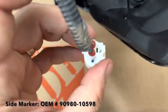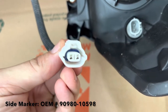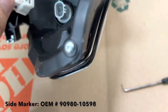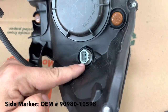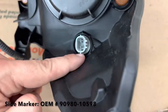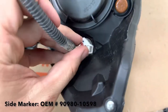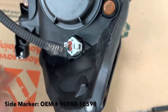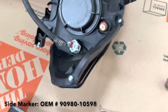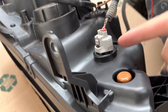Use a dental pick, and then the exact same wires just pop out and slide right inside and lock in. They have a similar pin — the only difference is how the little plastic tabs are designed on the third gen side marker piece. Either way, this is the correct way to do it. Snaps right in. That's for the side marker.